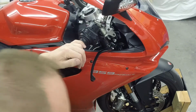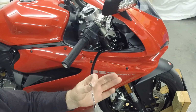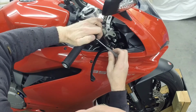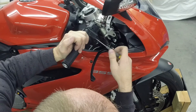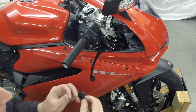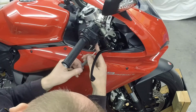And then you have these silver screws, which have the 3-pronged heads on them. I've just been able to use a small flat blade screwdriver. It works okay. Better to have the appropriate tool though if you have it. You can see they screw in pretty easy. For the bottom one, make sure you put this plate in. And this plate, that's where the zip tie goes for the wire that comes out of the sensor.